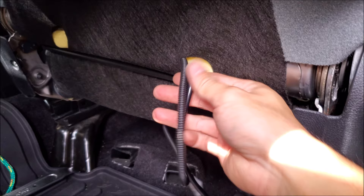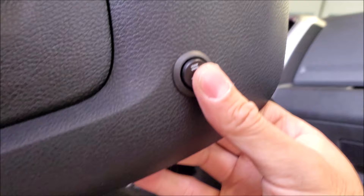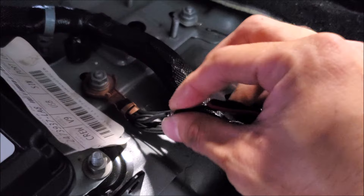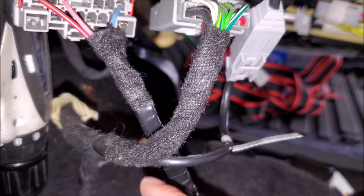Run all your wiring along with the factory wiring. Drill a hole for your control switch and press it in. Here's our wiring under the seat — all run with the factory wiring and our relay mounted. For ground, we're soldering onto a factory grounding point. Then find a good switched source that's either already fused or install a fuse on top. All taped to blend in, and we've hidden our fuse under the seat.